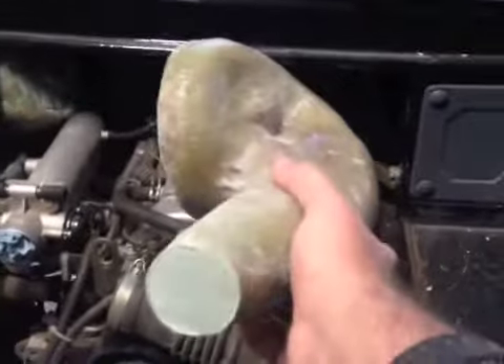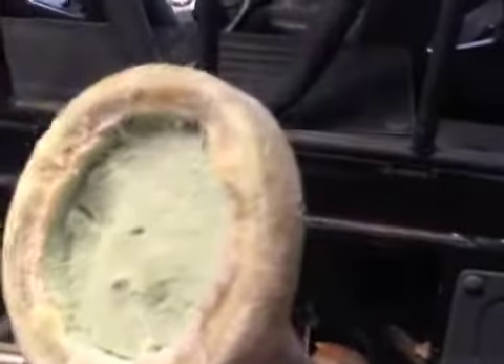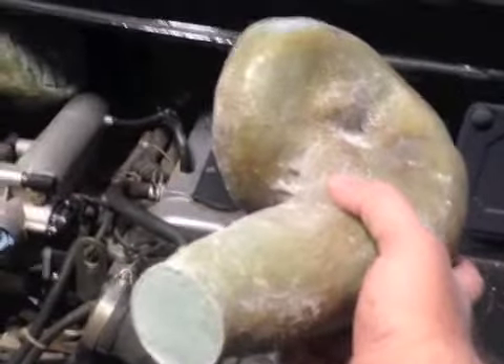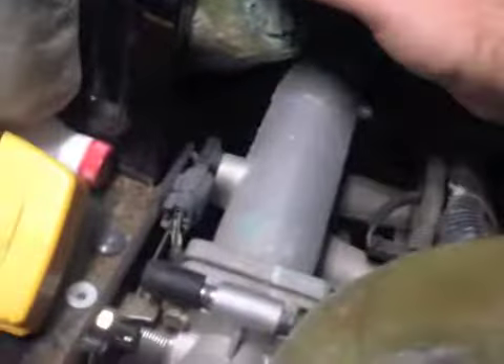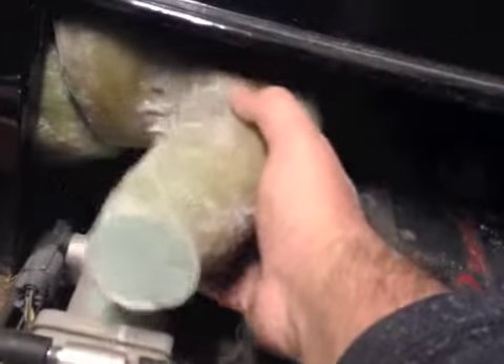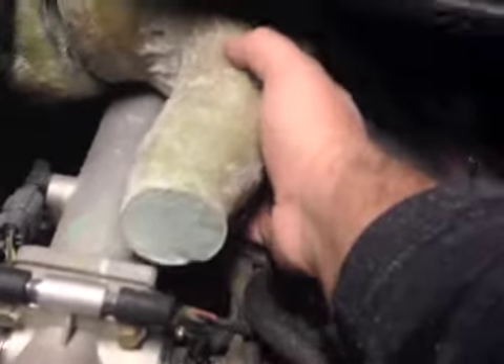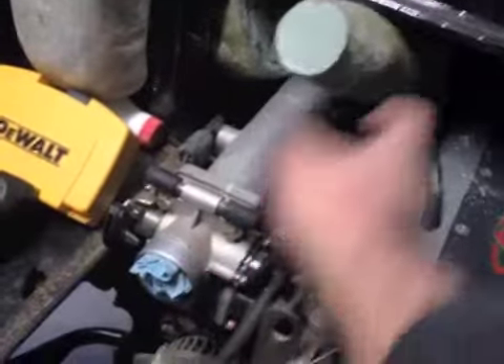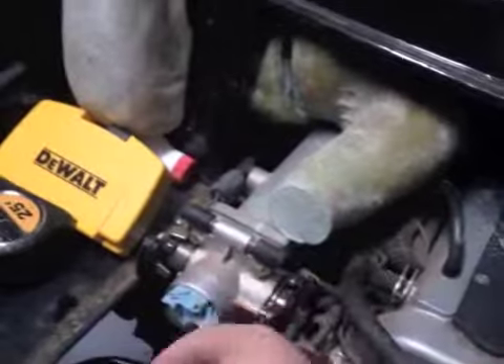I had the issue of running a hose or how I'm going to get this thing going. I did a lot of research on the best way to compress this air and get it flowing in there smoothly. So I built a plenum that pretty much takes all that air and forces it into a two-inch hole where the throttle body is. Once you've stuck the air filter right inside here, this thing just kind of slides right up under here and it's just going to connect and seal tight with silicone. It's going to run right next to the throttle body, and there's a silicone tube — a 180-degree tube — that goes from here straight in.